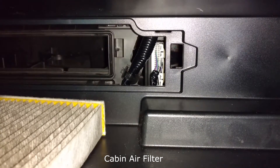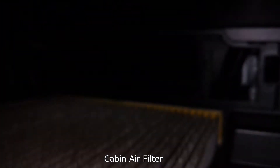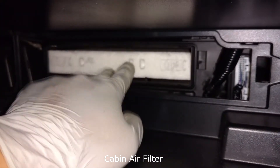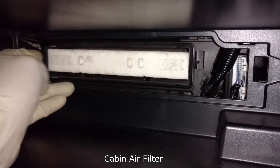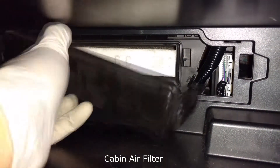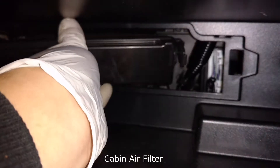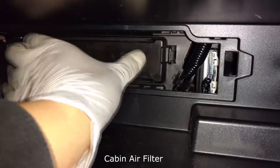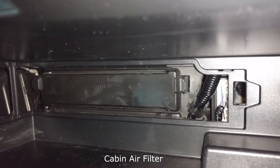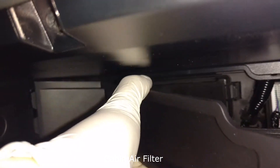These things get dirty a lot quicker once they're already dirty, and it makes your car a lot less efficient. We're gonna replace it later, but for now we vacuumed it and it looks a bit better. When you put it back in, remember your C's face front and the 'up' marking tells you orientation — slip it back in. This one's much easier to fit in. There's that border and that border, so there's no margin of error — no way you can actually screw up. Remember it says 'up' — put it back in the correct way.